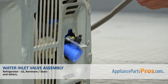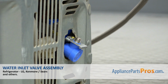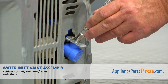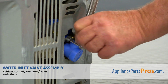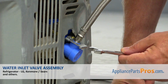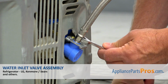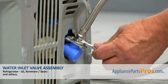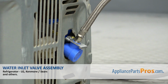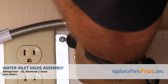Now going to connect the water line. First we're going to take off the cap. And now I'm going to start manually. And I'm going to use this 1/2 inch open end wrench and tighten it. Don't over tighten it. There we go. Plug the fridge in, open the water, and check if there are any leaks.